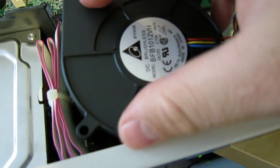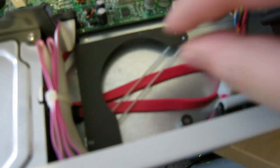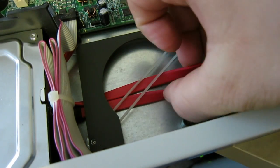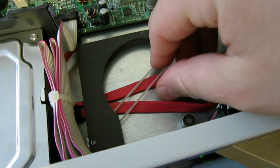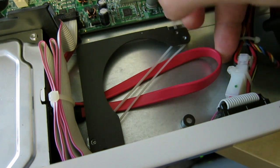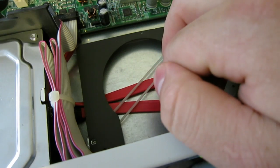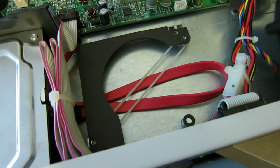Out of all the little things this company did to this rack mount unit to make it anti-vibration and keep all the connectors from sliding out, this is probably my favorite — the fan bracket. With a blower style fan it sucks in from the bottom and shoots out the front. What they've done is put a wire tie going from one post of the fan mount to the other, just to keep the serial ATA hard drive connector from flapping up into the blades. I've never seen anyone do that. It's really simple and cheap, but most companies wouldn't go to that effort.